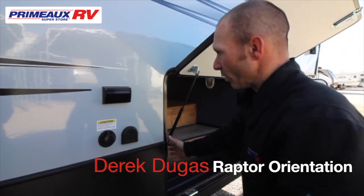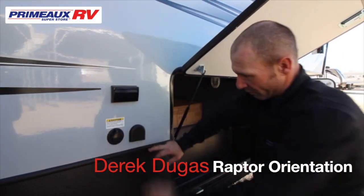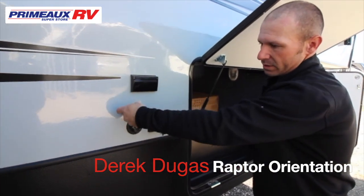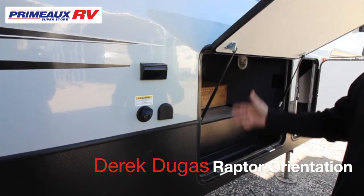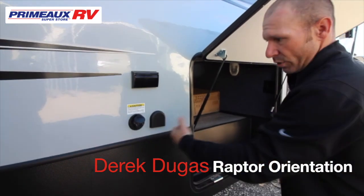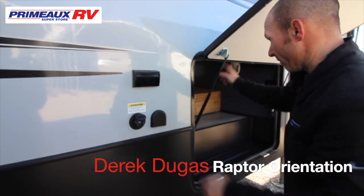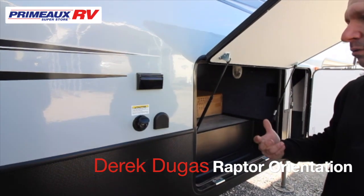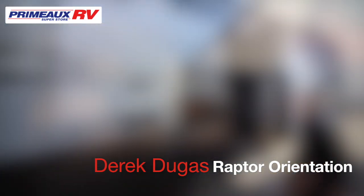Right next to the compartment door, you're going to have a 110 plug. This right here is just a tank vent. And here is going to be your black tank flush for the front bathroom. So once you're done camping, when you're going to pull out, you're going to take your hose from the city water, run it here, turn it on. There's a wand inside, it'll spin and it'll wash out your black tank.